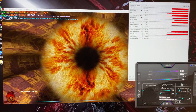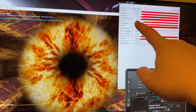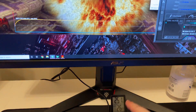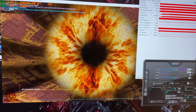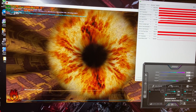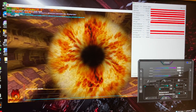The temperature appears relatively stable now with GPU temperature around 77 degrees and the hot spot around 95 degrees Celsius, which is not optimal given the ambient room temperature of around 25-26 degrees Celsius. Cooler room temperatures might help a bit, but I don't think this is an optimal cooler even for a 6750 XT, let alone the 6900 XT. I'd definitely suggest you switch to better thermal pads or try water cooling this card, because I don't think it will last well at these temperatures.